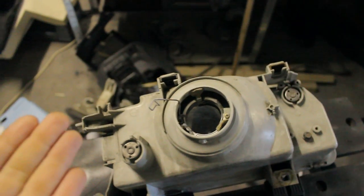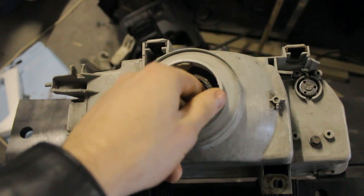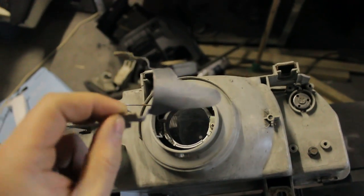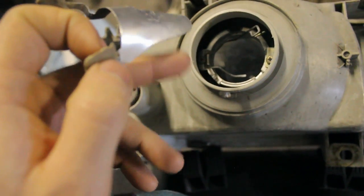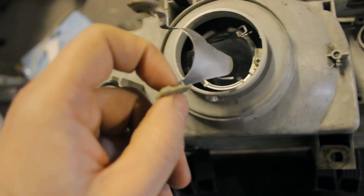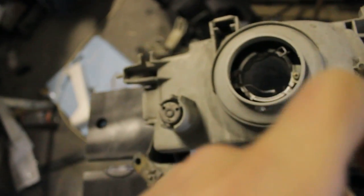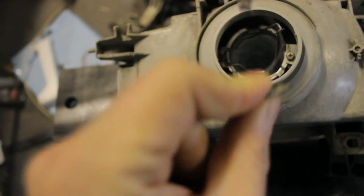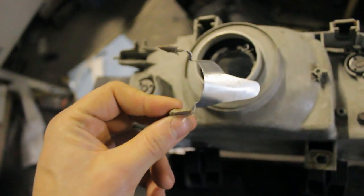There is a way to modify your headlights to have a legal beam without making it look modified from the outside, and that's with a bracket like this. These brackets are rather simple — they block off part of the headlight beam. Once installed, it will block off the top-left part responsible for the upsweeping beam. It's placed in the bottom right due to reflections inside the light itself. This is the method I'm going to use for the Honda Beat.